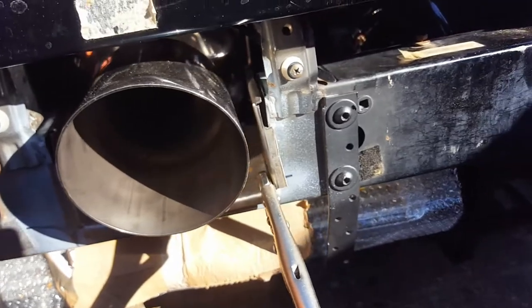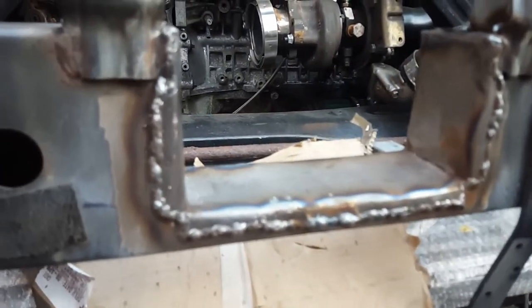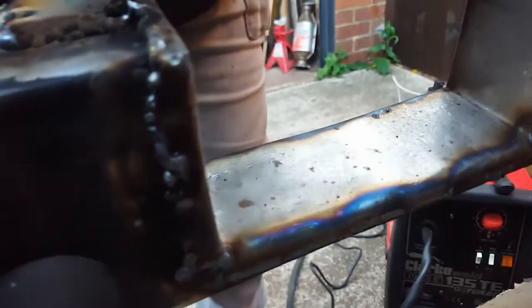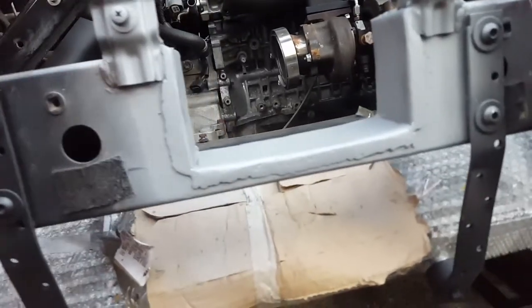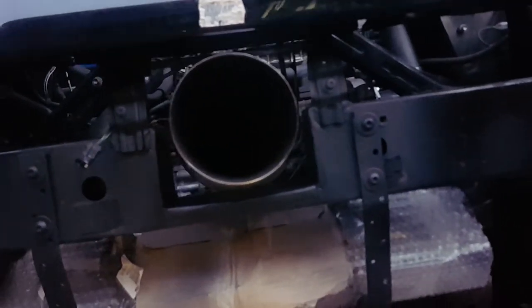Just like that — it's the return of Frankenstein's monster. The welds aren't the greatest, I'll be the first to admit that, but it's strong and it'll hold. I've put a strap across the top for reinforcement and then down the back — the back's even worse but it'll hold. That's my lovely little square for my exhaust. I've ground the front welds down so they look a bit prettier, and I've put some zinc galvanizing spray on there — I think I'll just spray it black now.